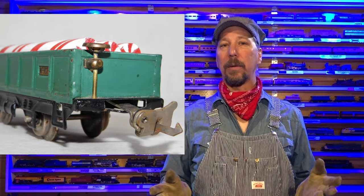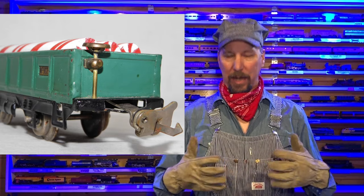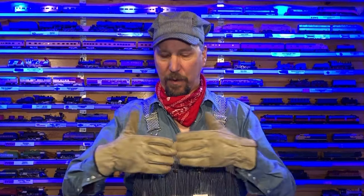The latch coupler is supposed to allow automatic coupling backing into it, and they're supposed to lift up and click in and everything like that. Since they're mounted on a rivet on the body, it allows the arms to flex around, so you've got to line up the couplers, and all it did was create frustration, and everybody always ended up doing it manually anyway.